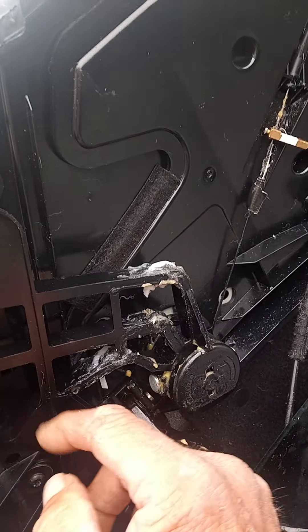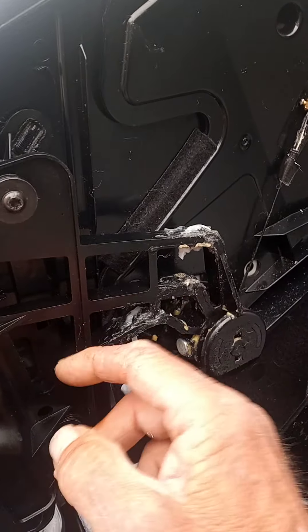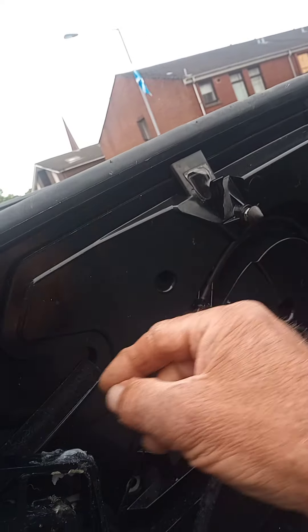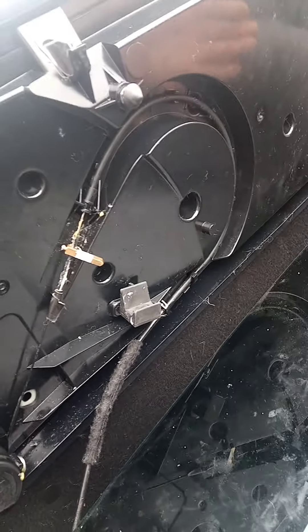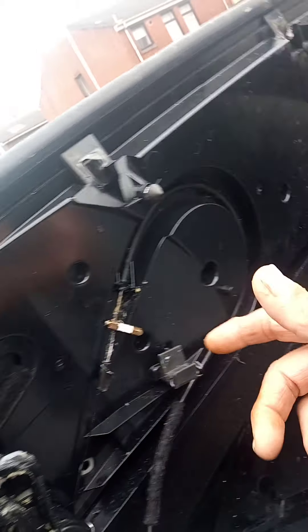This should come in useful for both Megane owners, probably Volkswagen and Cabriolet owners, and I think the Peugeot is much the same. The trouble is because of this spring going loose - the spring loses tension. I'm going to add another spring between these two, or I might use some elastic or one spring in the center with a line going either side. It doesn't really matter because it's completely hidden when the roof's down or up.